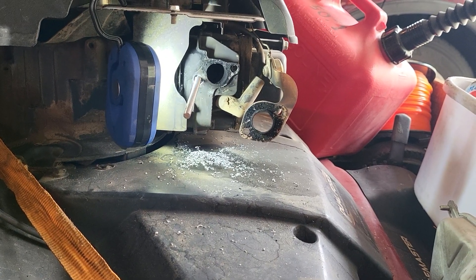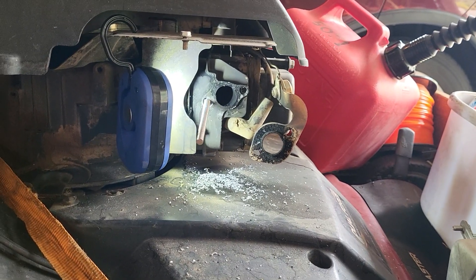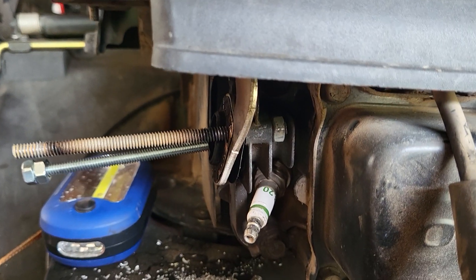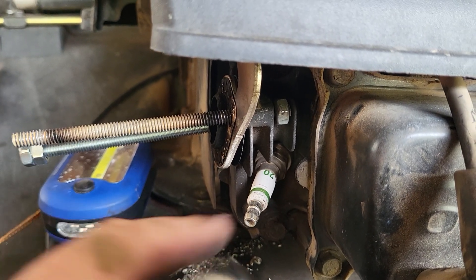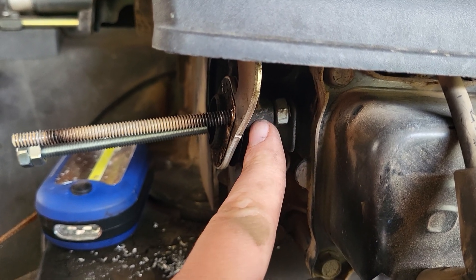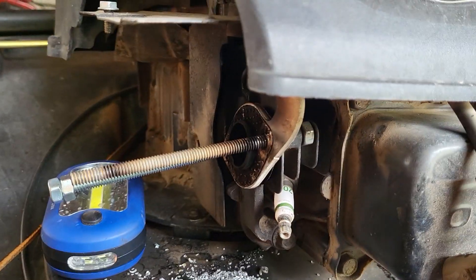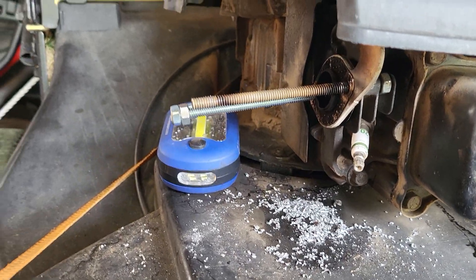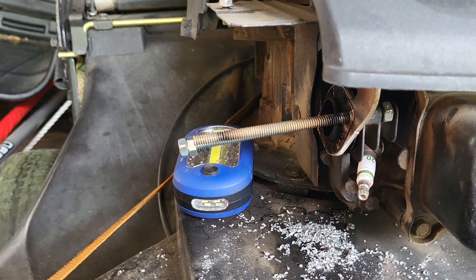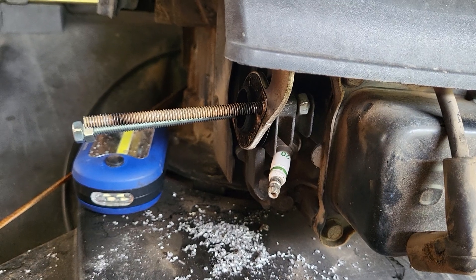Hopefully I can get a couple more seasons out of it. So here's what I mean — I've got this threaded rod here, and it's attached to that nut, and it's in between the fins since it's a through hole. Now all I need to do is just slide the spacer and then the muffler on, and tighten the bolts down.